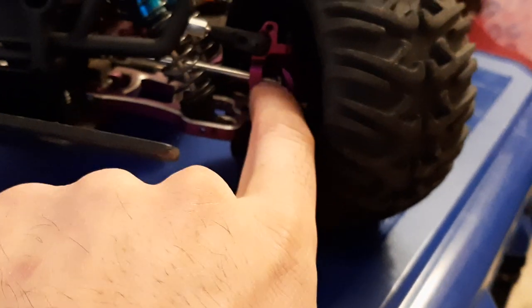What this does — if you look at the way the tires sit, you want them to stay parallel and travel in a parallel line. When they're from the factory, you push down on them and they tip in, which causes the axles to push into the differential cup and into the stub shaft. That binds the axle. While it's rotating, it's bound — there's too much pressure, and it won't allow it to spin freely in the axle stub cup or the diff cup side.